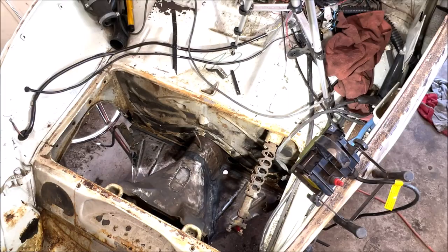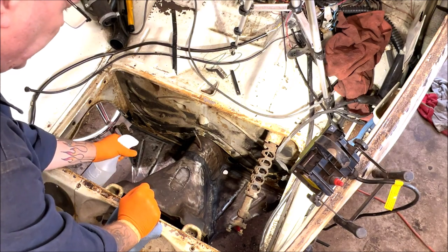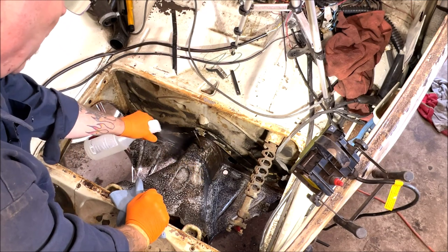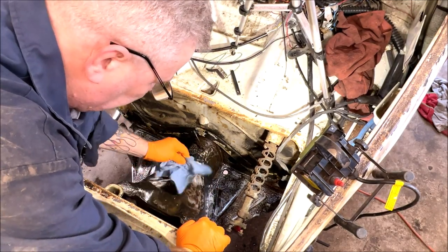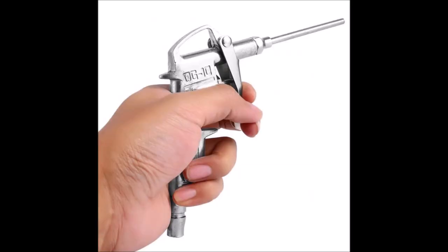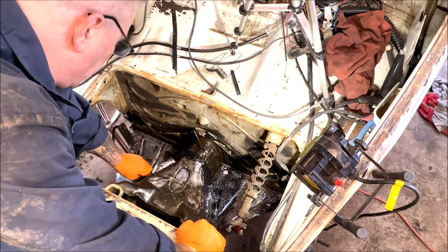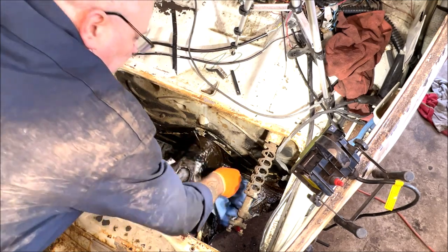So we have our Metal Blast — it's a surface conditioner. Make sure you turn the nozzle and spray it on well. Like I said, it works like an etching primer — it helps the paint bond to the metal surface. I'm going to let it sit a second and then wipe it off. After I wipe this off I'm going to use my blow gun from the air compressor to blow everything out of there — you never know. I try to get everything as clean as I possibly can so the paint adheres well and you don't want any moisture on it.